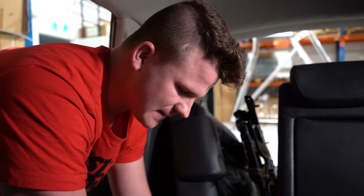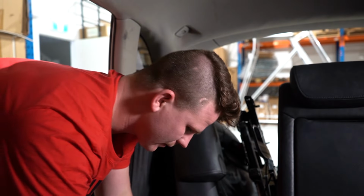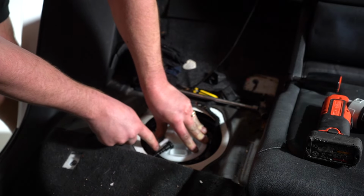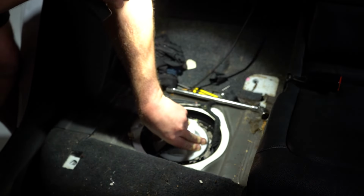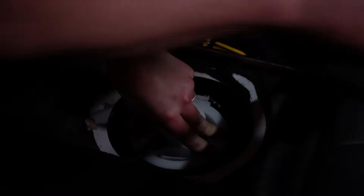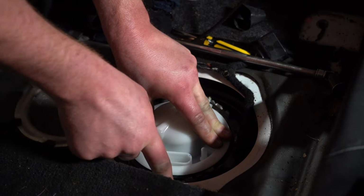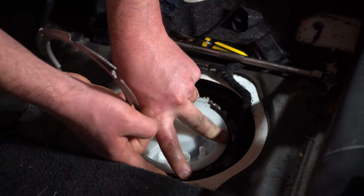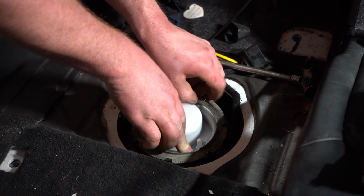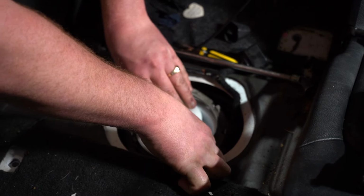Another thing, when you put that seal on, make sure the two rods stay in the bottom housing. It's important. Right, so I've firmly applied pressure whilst making sure the seal stays around the edge of the pump evenly. It's all the way around the edge, so it looks quite nice, and that means the seal is properly serving its purpose, and we can now bring the little ring back. This has been annoying the entire time, just putting it out there. We can bring the ring back, and hopefully if that little pipe pops out of my way, as long as it goes on top, it's okay.